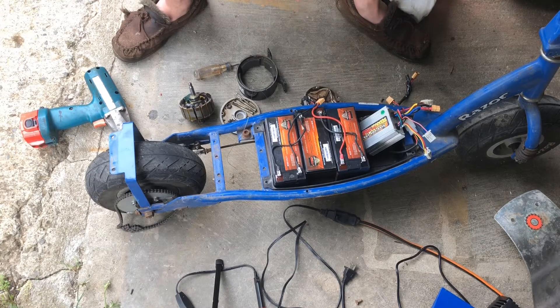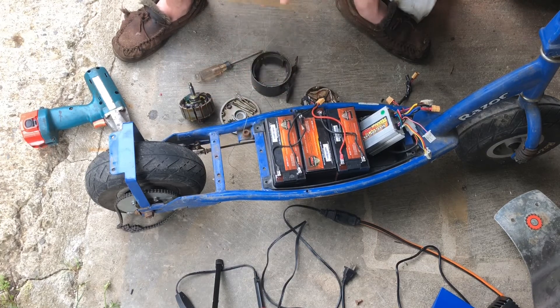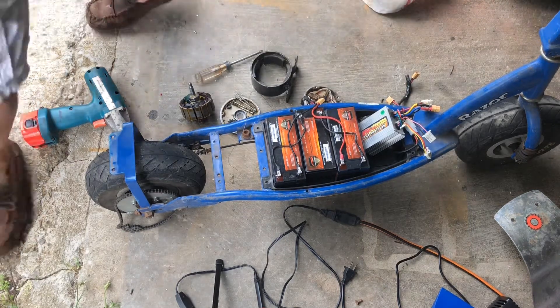We took the motor apart and we're replacing it with a 24-volt 350-watt motor coming tomorrow, and eventually a 24-volt 500-watt motor to really beef up the size. The motor bolts in right there. Top speed probably won't increase much, but what I'm really interested in is torque. Even with the overvolted 250-watt motor, it started climbing hills that the stock scooter wouldn't even dream of, so I'm pretty happy with the setup — it's obviously a work in progress.